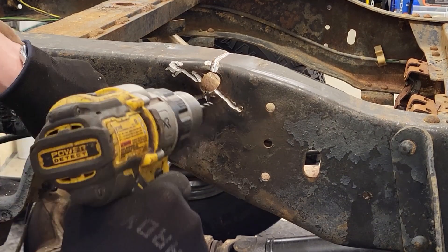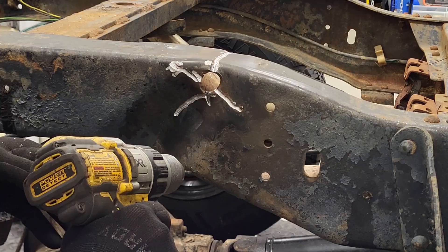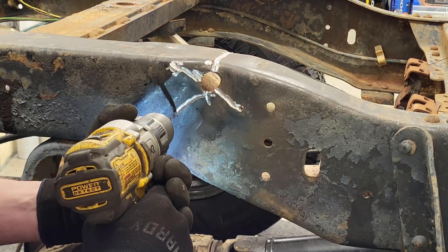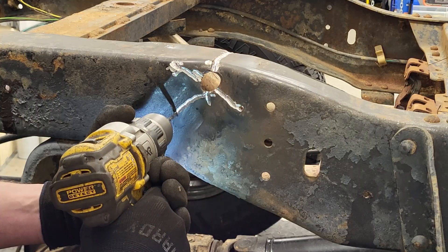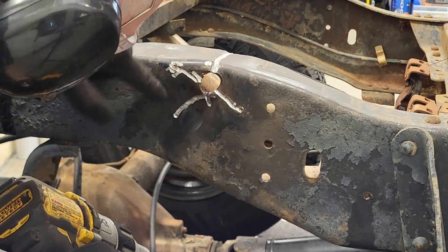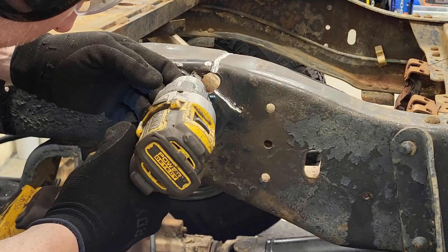What I'm doing now is I found the end of each of these cracks, and I'm going to drill a hole in it to make sure that it doesn't spread afterwards. All right — one, two, three, four cracks here, that one joining that one.